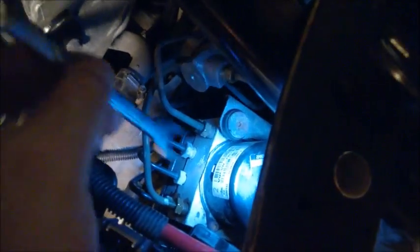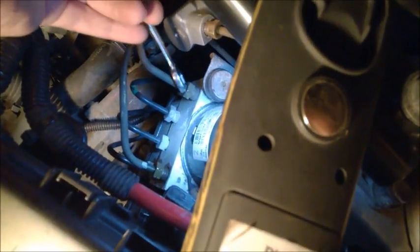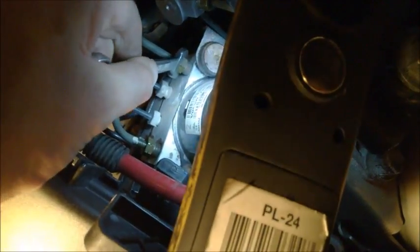You need to give them a good kick to loosen them — they are really soft. So I'm going to keep the pedal depressed, then open the lines one at a time and see if there's air coming out. By the way, don't forget to wash everything down with a water hose — not to watch, but because it's brake fluid, it's kind of corrosive.